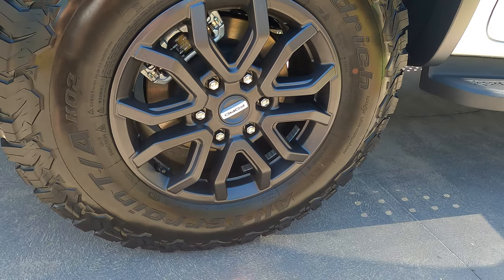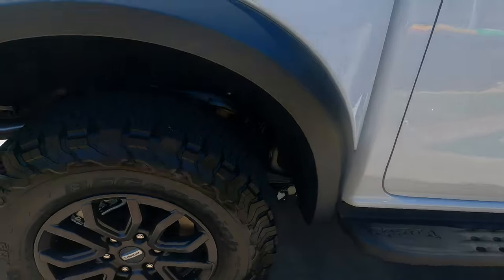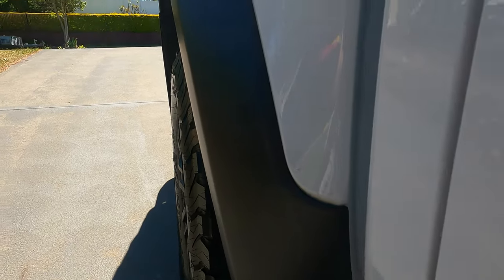The main reason we're changing these is just because of offset. These tires are definitely too small for this car, but I want to go to all-terrains, so I figured I'll give these 33-inch ATs a go. I think I want 35-inch all-terrain tires, so I'll run the standard BFATs and then make up my mind whether I'm gonna keep ATs or put muddies on it. If you look down the guards, that wheel actually sits well inside the guards, so if I put it against any banks, it's gonna smack the panel, smack the flares.